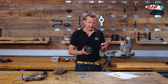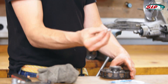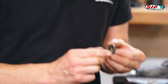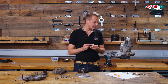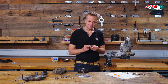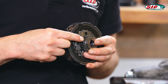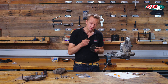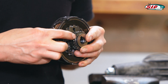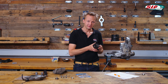It's easy to remove by using a wrench, or you can mill or grind it away — no problem. Then put in the Woodruff key on the crankshaft. Next, this washer disc between the bearing and the clutch — it's important to have the right thickness. In most cases 3.5 millimeters is correct for modern PX type engines. It's also important to have a small gap between the clutch teeth and the washer, because when the clutch needs to release, it fills up this gap, moving very slightly — about 0.1 millimeter. It needs space for that. If the clutch gear is resting on this washer from the very beginning, it will not become loose.